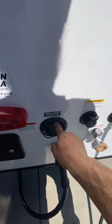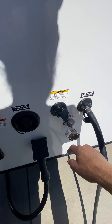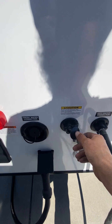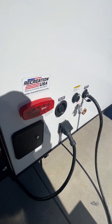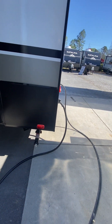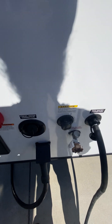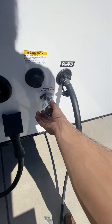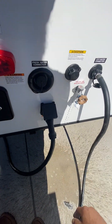Fresh tank fill is here. This here is going to be your black tank flush — whenever you hook your water hose to this, always make sure your black tank handle is open. If that tank is already full it will come out the commode or out the vent on the roof, and you don't want that. City water hookup is this one, and this here is your outdoor water power cord — comes with the camper.